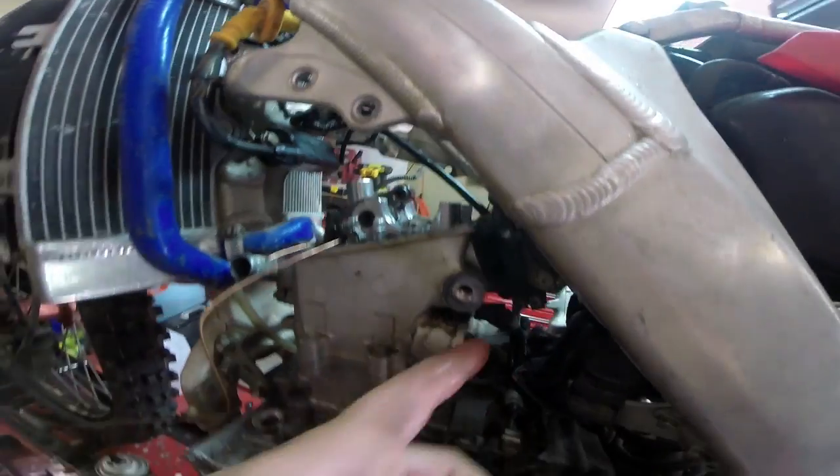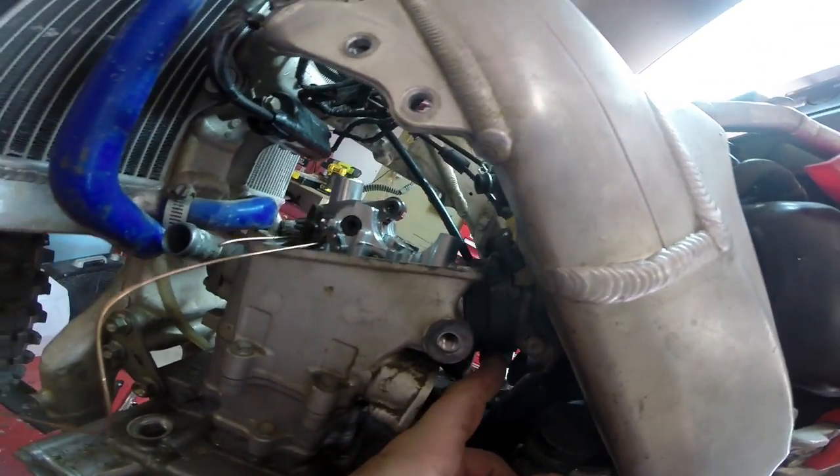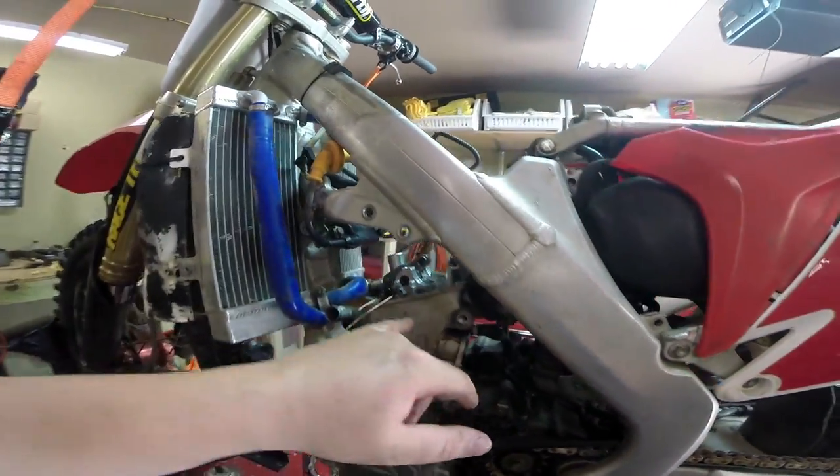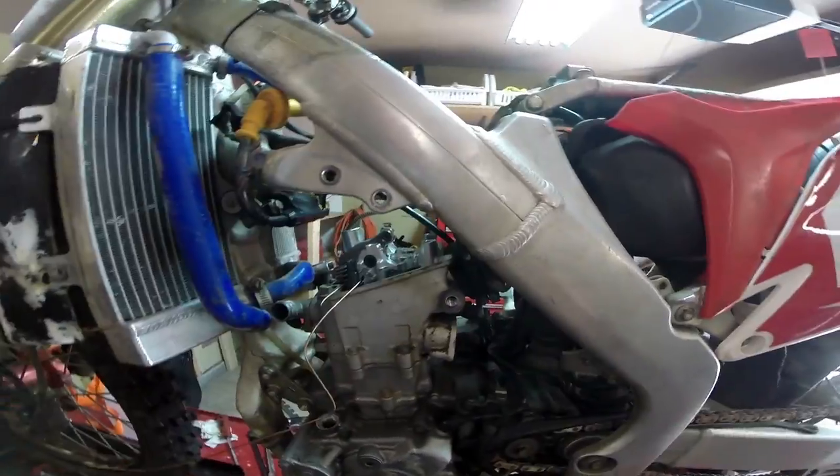At this point we have to unhook the intake throttle body — because normally it's a carburetor but not here. Then we should be able to remove the safety bolts and the main head bolts and pull off the head. Nice thing about dirt bikes is while they are expensive to rebuild, they are designed to be rebuilt, especially a race bike like this. You just blow them up — that's just part of the business — and they're not too hard to take apart.